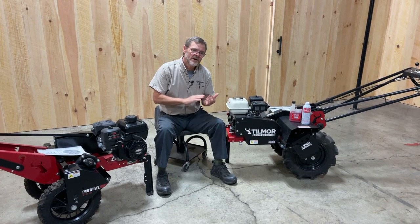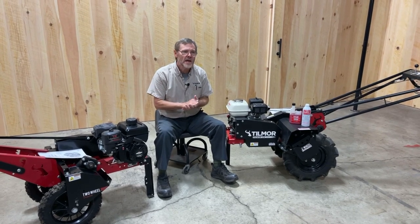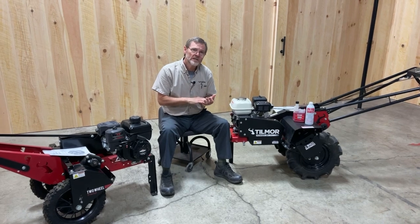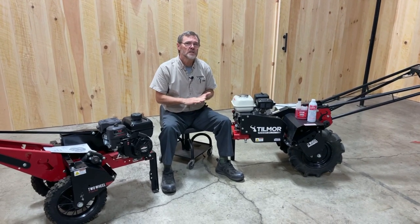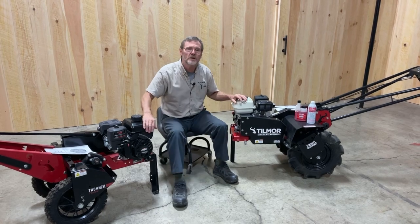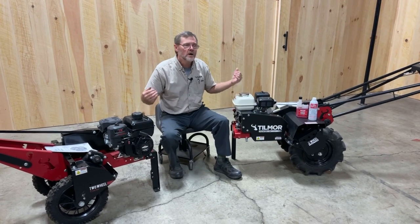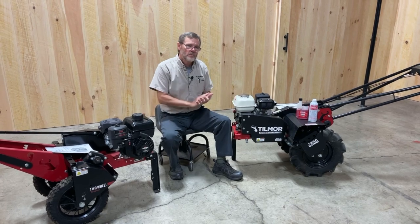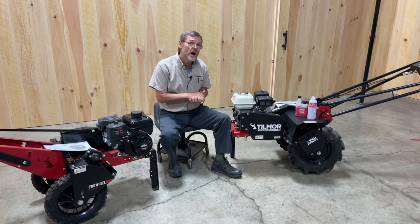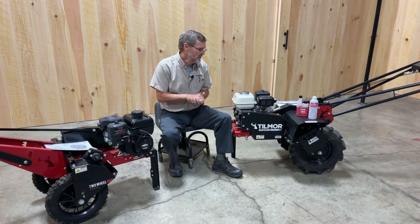And there's a lot of debate on the internet about, is ethanol bad or is it okay? I'm not going to argue one way or the other, but I will say that ethanol is slightly more corrosive to plastic parts than your standard fuel. And so inside these small carburetors, there are plastic parts, and that I think can often be a cause of problems. So we recommend premium grade fuel, higher octane, clean. Make sure your fuel tanks are clean, your containers, whatnot.